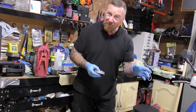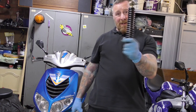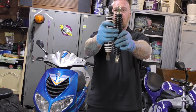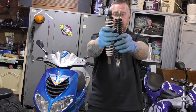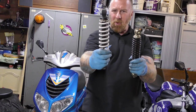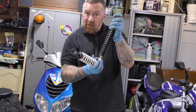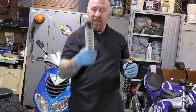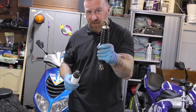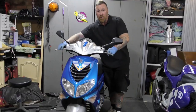I thought I need to go out for a ride, but no — I need to fix the brake and suspension first. He did say he had a brand new shock on the front and back. But that's a Speed Fight front single-arm shock — you can see this one is not for a Speed Fight. The torque on this one is completely different, it's bigger. I think this might be like a twin rear one — it isn't capable of holding the front of this. So I'm going to put the correct one on, do the bounce test and prove that while this may be new, it isn't for a Speed Fight.